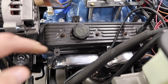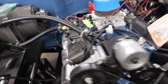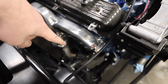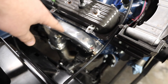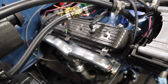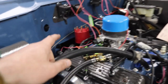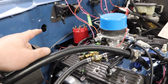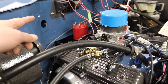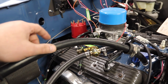I tried to do the wiring but these ram's horn manifolds are kind of a pain — you can't really go over them cleanly, and going under them has heat issues. So I ordered a set of Corvette heat shields that basically protect the wires, and I can run it under the engine block and up to the distributor for a super clean install. That giant hole in my firewall is for a 22-pin bulkhead fitting, so I have a nice seal and I can unbolt and disconnect the whole wiring system from the chassis.